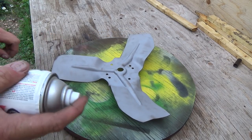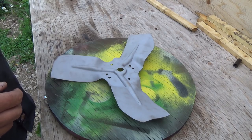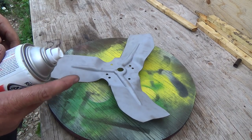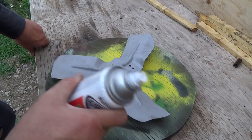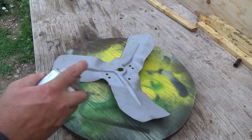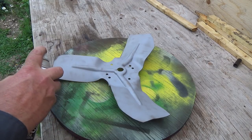This is one of my favorite things to do — actually painting. Normally I do it in my garage down there with the vent that'll suck it out. Primer has a lot of solids in it, so you really got to make sure you shake it up really good. What you want to do is on, off, on, off, on, off — don't hold it on because you'll get a big puddle at the end.